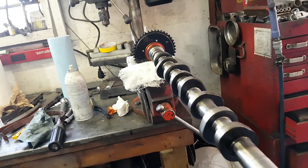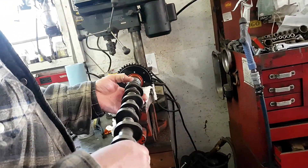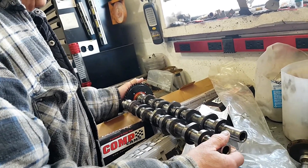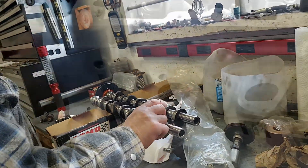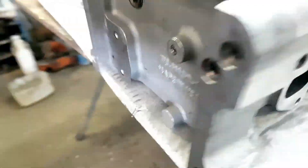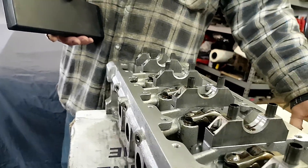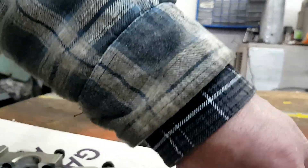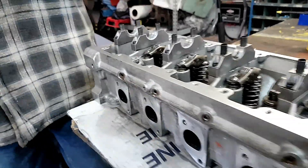There's a little bit of information in the Hot Rod magazine article. They always got a lot more duration than this cam has — you can tell just by looking at them. See how much rounder this one is? Longer duration makes more power. At least you know how much lift — look at these. Oh, that's rough. So it wouldn't have seized up all the time? The back one wasn't so bad and the front one wasn't so bad. It was all the rest of them taking the strain — because the cam is pushing this way all the time.